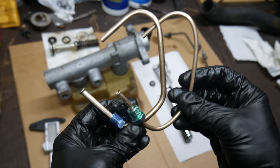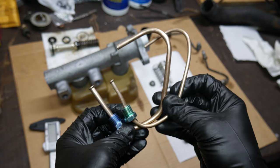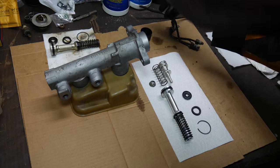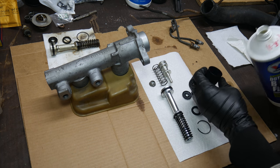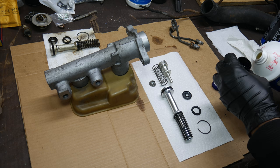For reference, this is kind of what we're trying to replicate here. I made these little brake lines to make bleeding the master cylinder on the blazer really easy, but the flare nuts don't match this reservoir so we weren't able to use them. We'll be able to use the short lines we removed from the car in order to bleed everything cleanly and easily. But before we get into that, of course, we'll have to get the master cylinder reassembled.